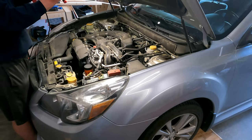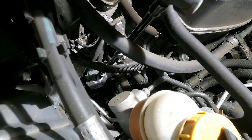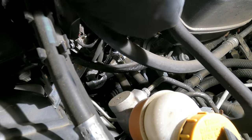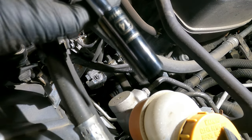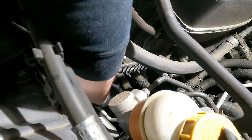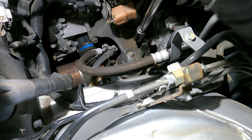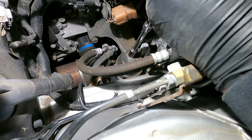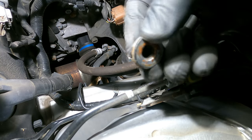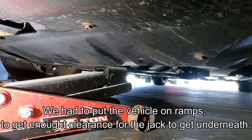The next thing I'm going to do is loosen those motor mounts. Here's the first one — you might need a couple of extensions. I've got two six-inch extensions with a long socket to get all the way down there. Here's the passenger side motor mount — we're just going to loosen it up and remove that nut. Now we're going to jack the motor up just slightly to give us a little more access to get to the spark plugs.